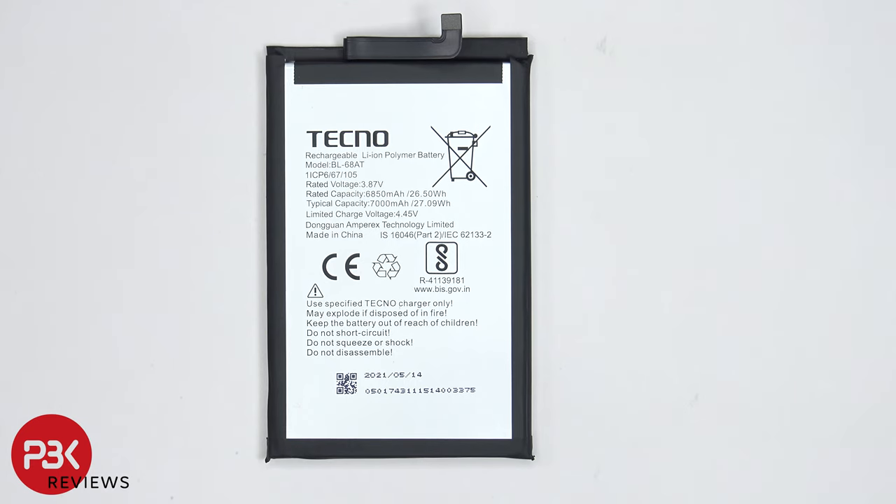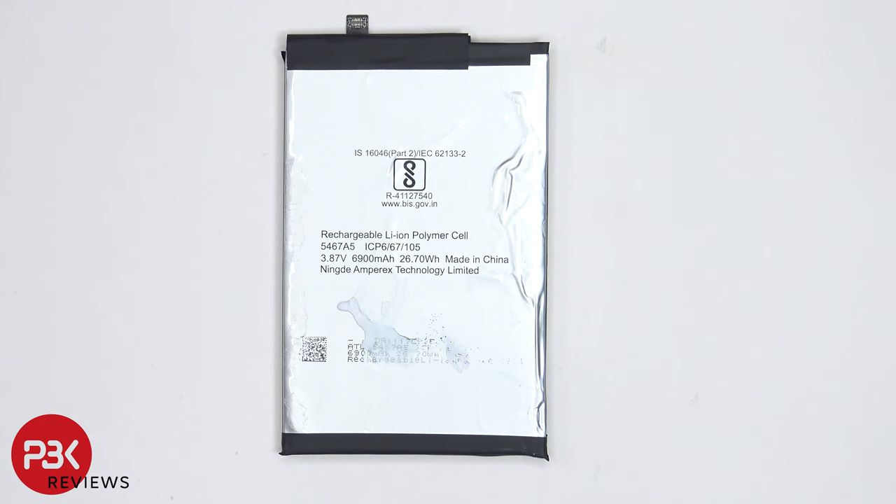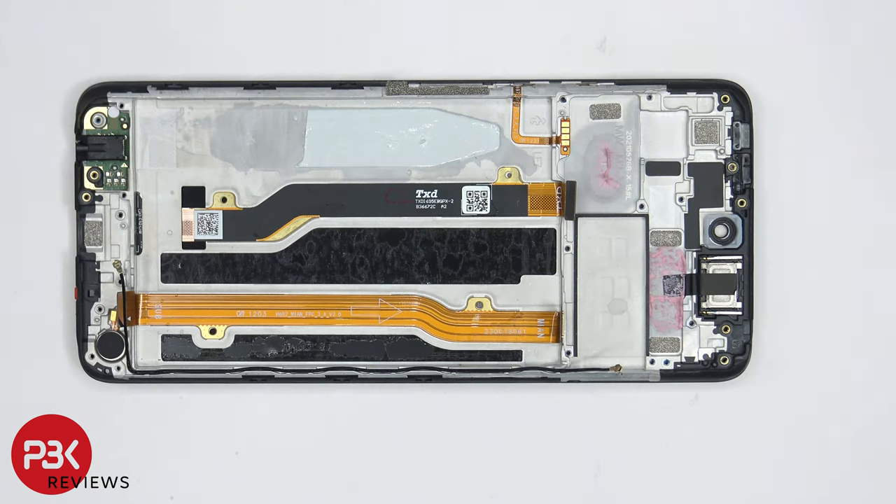Here's a better look at the battery. Once the battery is removed, we can see this flex cable over here for the screen which is routed through the opening over here in the mid frame. We can also see this flex cable over here which connects the main board to the subboard. So when it comes to replacing the screen, you need to remove the back housing as well as remove the screws on the top back cover and remove the top back cover, disconnect the battery cable, and the cable over here for the screen.